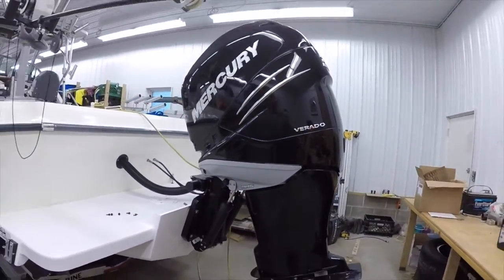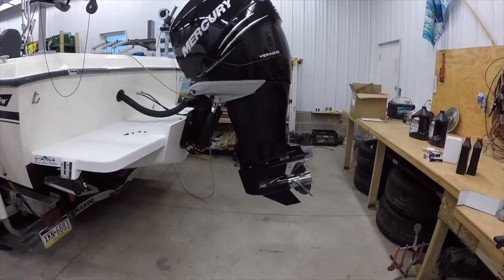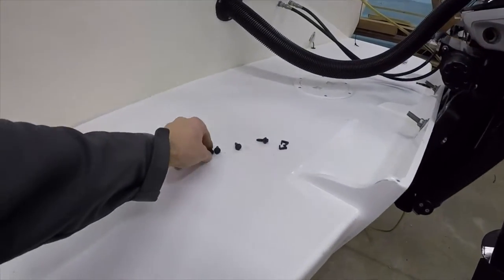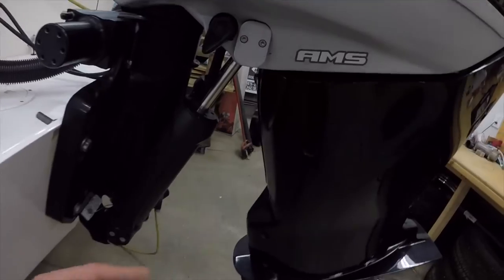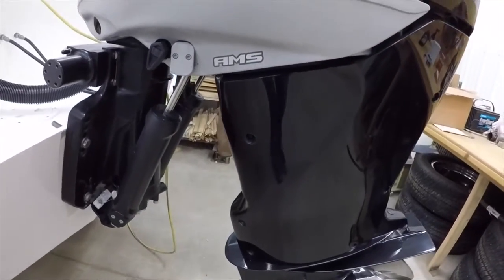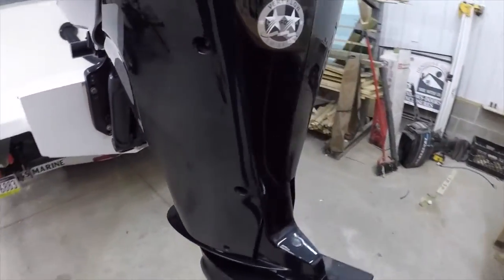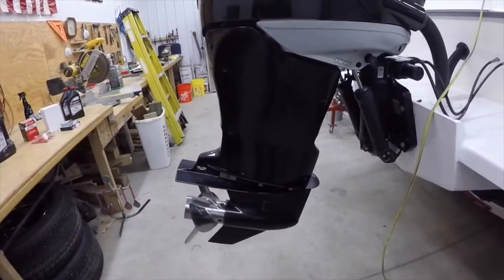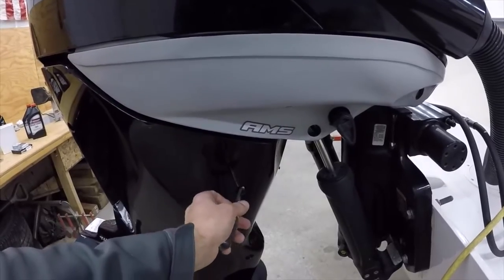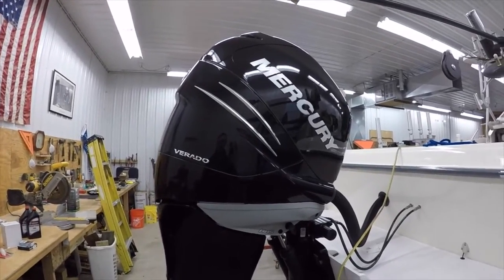The first thing we're going to do is take the cowlings off the top, the back, and then the chaps. We want to pull all the bolts. You can see I've actually started to pull some of these, and there are a couple of plastic clips that hold the chaps together here in the front. You want to remove these clips and take out all of the bolts holding the chaps on — a five-sixteenths driver will allow you to take these out.